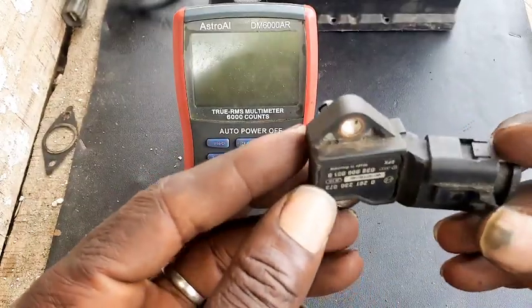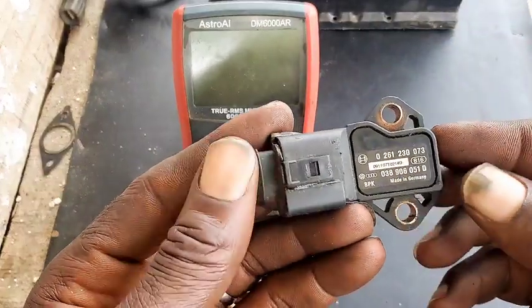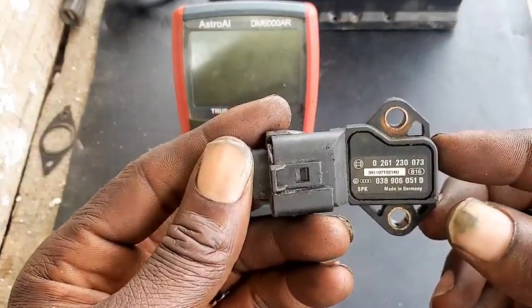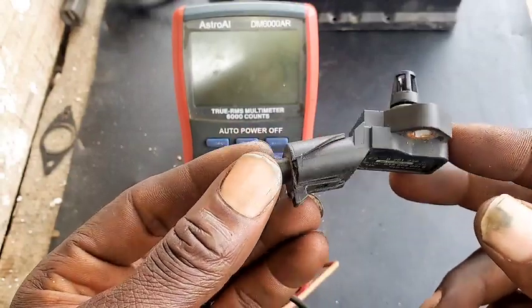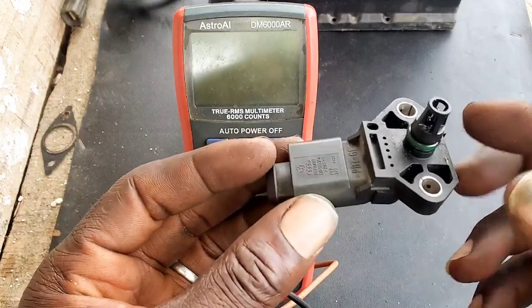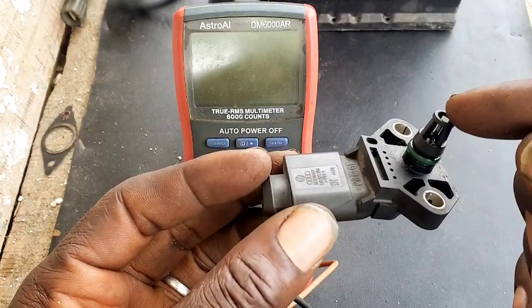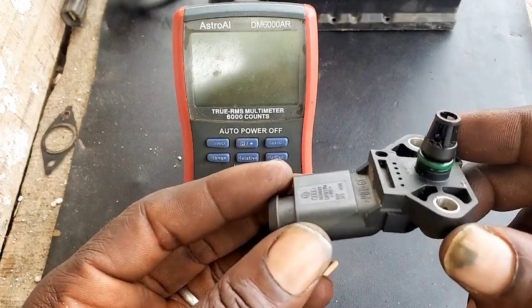Now if you take a look at this vividly, you might not notice that there is a difference. Let's flip it this way — there is a difference. The reason why is because this one is put out of the turbo wastegate circuit. And if we flip it this way, something is missing. There's supposed to be a resistor, a thermistor here — a negative coefficient thermistor — which acts as the intake air temperature sensor.